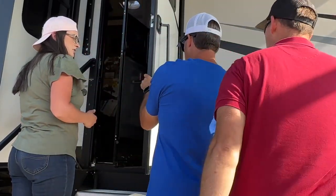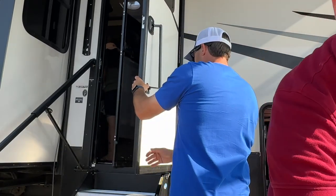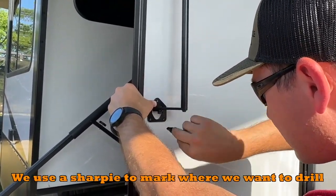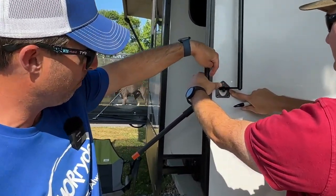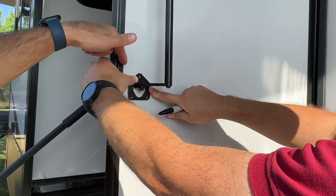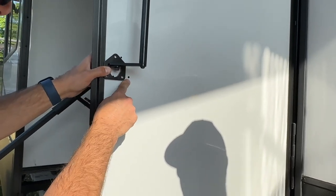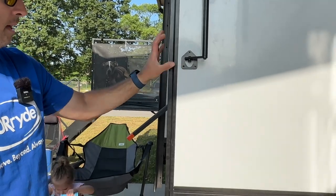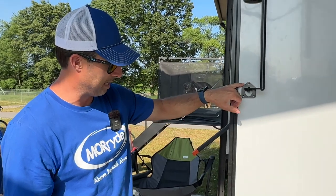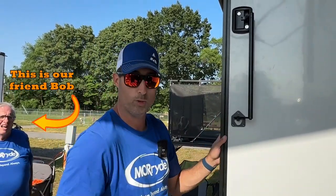Let's make sure the door cycles. You're wide open — you're good. Okay, let's put the marks. Basically, he's using the Sharpie. We eyeballed it to get a straight line, and most importantly, he got the home commander's approval. Once the boss said so, then we're using the Sharpie to mark it so that we don't mess up where we drill. Three holes will go through, so we only want to mark it once and drill it once, because if you screw this up it's going to be a problem. We'll unscrew this, put it back, drill the holes, and hang it back up. We're going to silicone it to keep any water from getting in, and it has a rubber gasket on the outside which will also help.